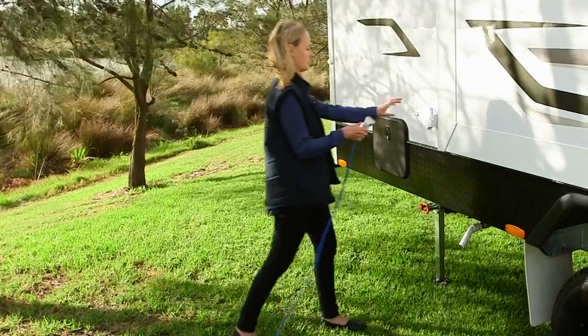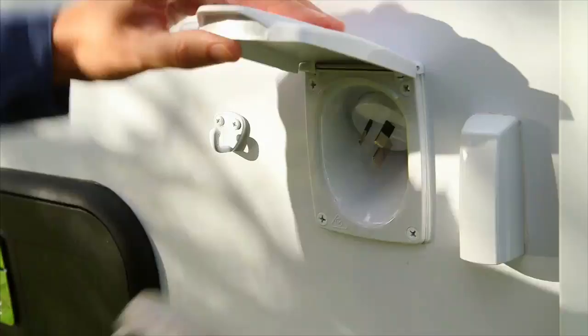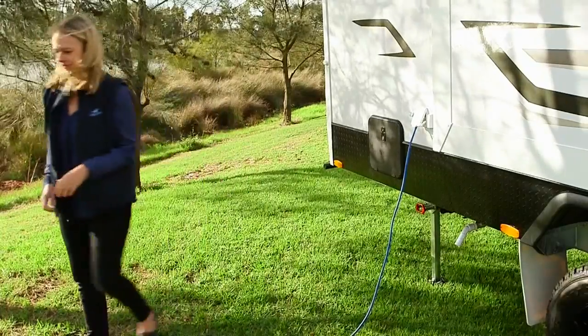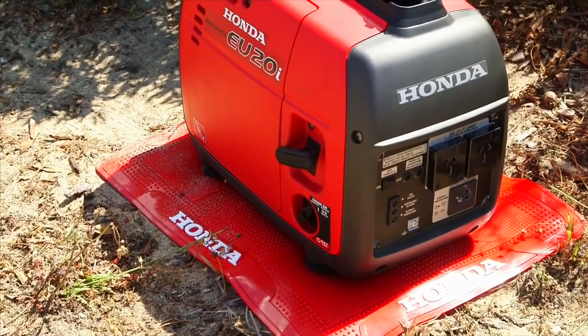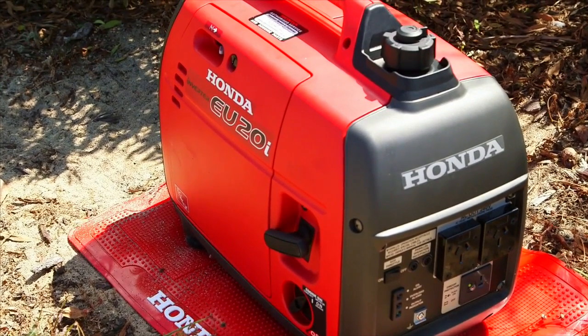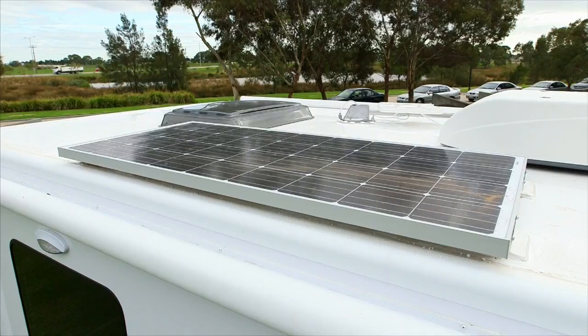It is imperative that your leads are 15 amps. This will allow you to plug in to a 15 amp site. Plug the mains power into the van's power inlet. If you are in a remote area or plan on travelling into such areas, we suggest that you talk to your dealer about a generator that is applicable to your van, or a suitable solar system, if applicable.